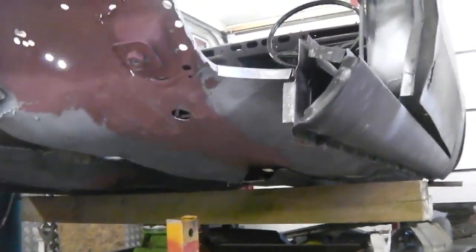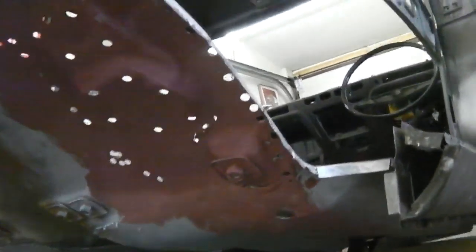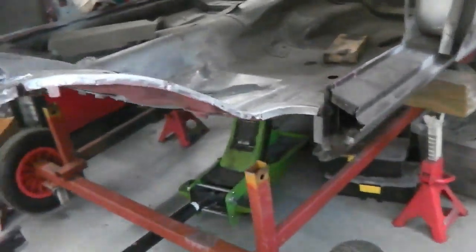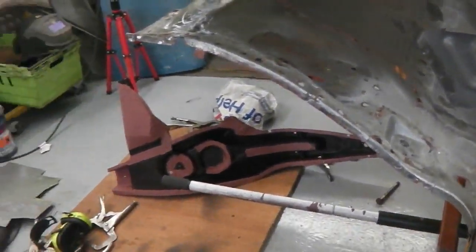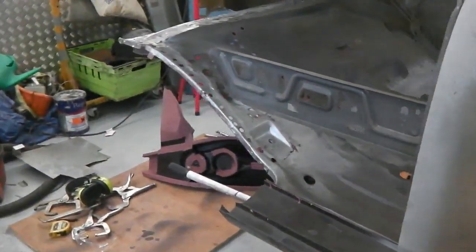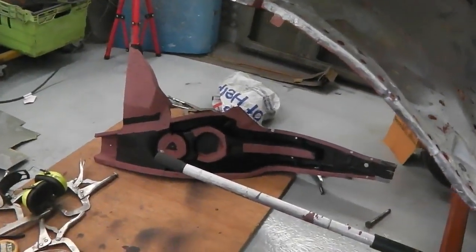Once we get it plug welded on, we'll clamp it and do all the C-clamps on it and get it plug welded. And once it's nice and tight and welded, because we're already with the weld through, we can then put the wheel tub on. The good thing about putting the wheel tub on is we instantly get the strength back where we needed it, and there's nothing to stop us putting the wheel tub on. It just wants a little bit of paint and the usual preparation with the weld through primer, but it is actually shot blasted back and treated and ready to go. So we've got ourselves a bit of fast action now. All the preparation stuff is done, and the bulk of the time,